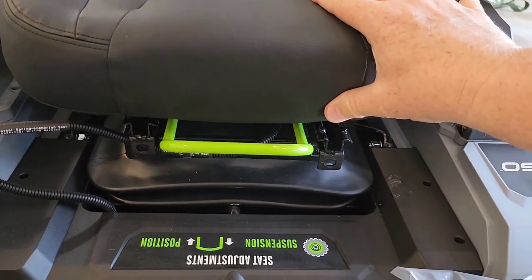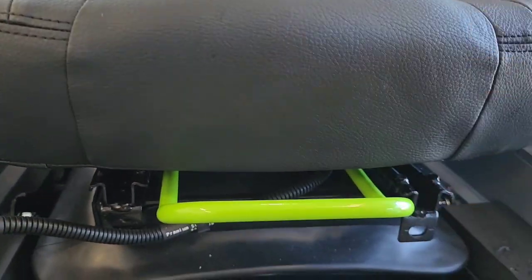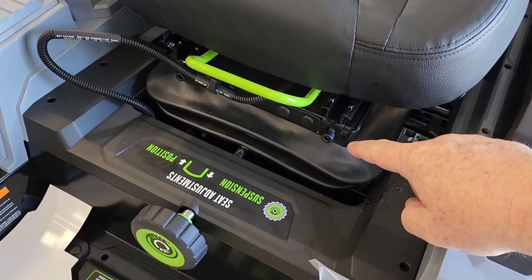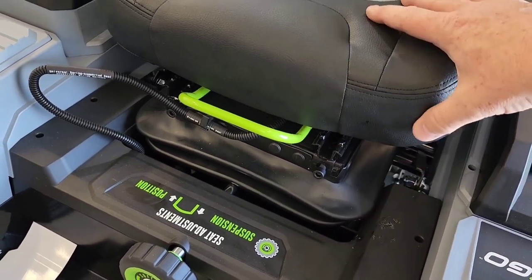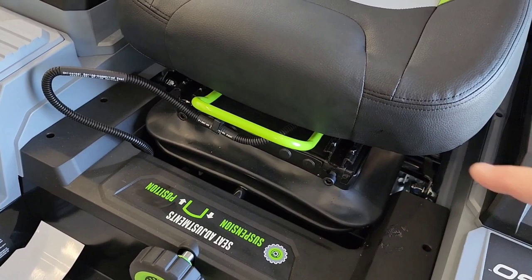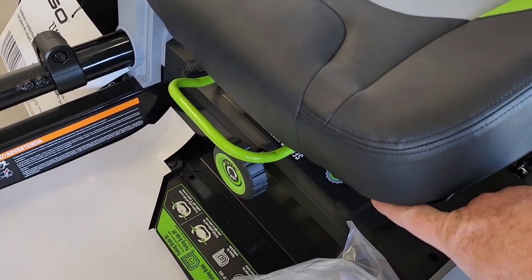Okay, now set the seat down and we got to put the two front screws in first. Make sure that wire harness is in front, but there's two holes we're going to line up. Now this proves to be a little tricky because one rail was out a little farther. So you may have to loosen or pull the handle up and get the rail to move, and it's going to swivel in the back. That's okay. We want to get these kind of started, then we're going to tighten in the back ones. Okay, leave those front ones, just tighten them down almost all the way.